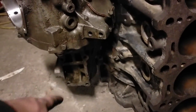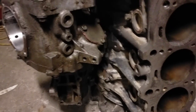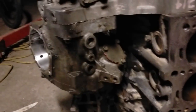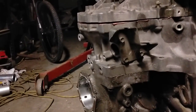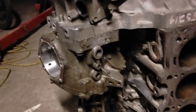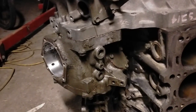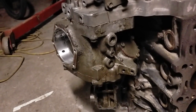What I'm going to do now is take off this part of the casing so we can get a good look at the actual clearance. Another thing we need to be mindful of is how it goes together - while it fits fine now, by the time we get a clutch and flywheel in there it's all got to be perfectly lined up. The way these go on is at about 15 degrees offset, then once they get towards the dowels they spin around and drop down. I need to make my best educated guess of exactly where the clearance needs to be during that rotation. I could put a crank in with a clutch and flywheel, but that's quite a big job and I haven't got a flywheel yet. So we're just going to take an educated guess, and if it needs a little touching up once the motor's all together, it's not a big deal - hopefully it doesn't come to that.